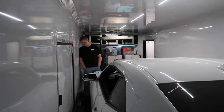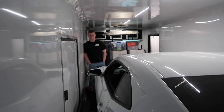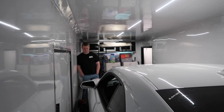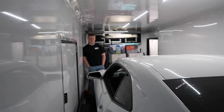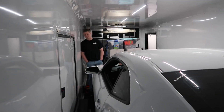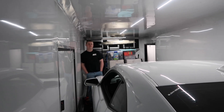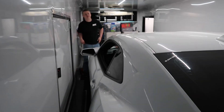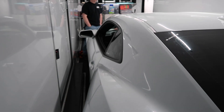It's a damn shame because these V-Series look so good. Even the car doesn't look nearly as nice when it's sitting up on the lift with no wheels on it. So the main changes to this car — we're going to look into travel limiters. They don't make any for this vehicle, so we're going to make our own travel limiters. Personally, we struggle half the time because it has too much extension on the front end. Before I never had enough, and now I have too much, so we've got to find that happy medium — just like the rooster travel limiters tying the front end down.